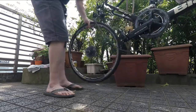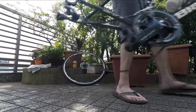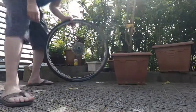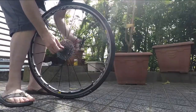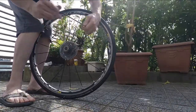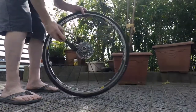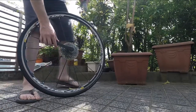First thing you're going to have to do is take off the rear wheel. Take it off. This is the cassette — take the skewer off first. To take off the cassette, you're going to have to get a tool in there and spin it off. Be careful, watch these little spring things — they can pop away. Set that to the side. Now I'm going to take the chain whip tool. There's also a socket wrench version; this is the one I have. Stick it in and put the chain whip on.